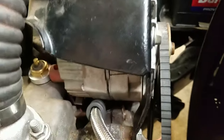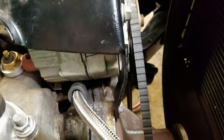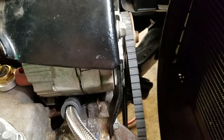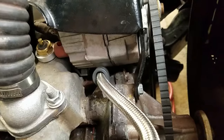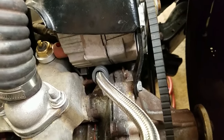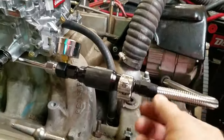As I mentioned before in the last installment, I have a clamp holding this in place on the back of the water pump and the timing chain cover. I found another bolt that's the same size and pitch thread and cut some more threads on it with a die, threading this through and bolting it on with a flange nut.